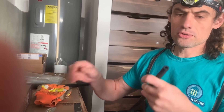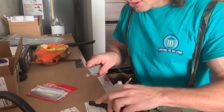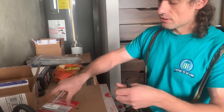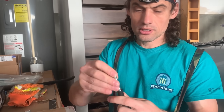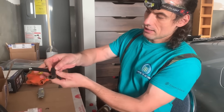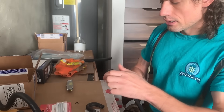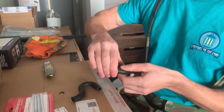First thing, we want to cut the hose because in the store they cut it, but you want to make it even and look nice. So go ahead and cut that piece as straight as you can. Next, find the tubing bender that will fit inside the tube — the largest one seems to fit just perfectly, though it gets a little wider at the end so it won't go all the way in. The most bend is coming on this part, so we want to bend this way rather than going with the direction of the hose. You can see how the spring tubing prevents the hose from kinking, so you want to leave it just like that.